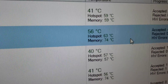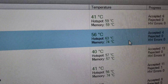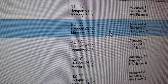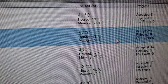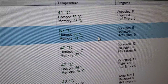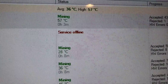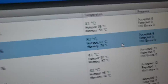Well, I'm glad I didn't give up on you guys. I got this guy in the green. Only a few minutes in, but temps are way better. So this last attempt, I took everything apart just to double check that the pads were sitting correctly and making good contact with the heat sink. All looked good. So this time I just made sure that the screws were nice and tight and then added those little washers. I don't know if the washers did it, but there's no dumb extra fans strapped to it. Nothing. It is just basic with fresh pads, fresh paste. So Gamer 1 is offline — that means the wife is upstairs getting ready to play Rocket League. I have to join her, so it is my time to go.